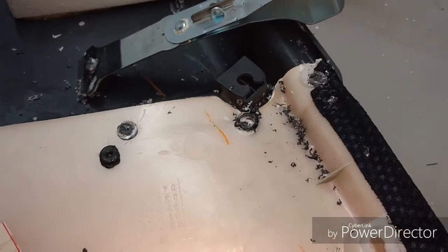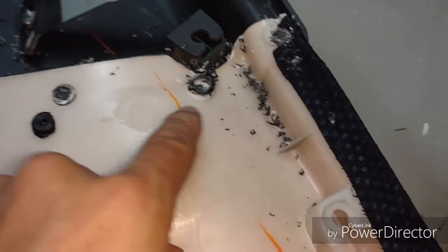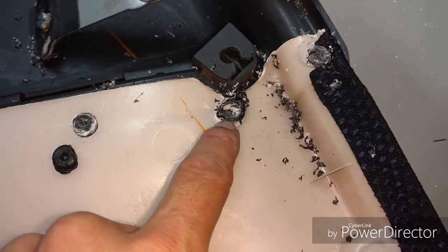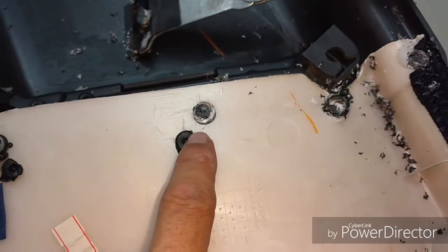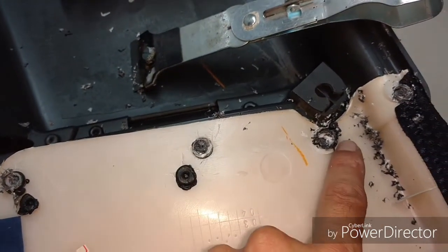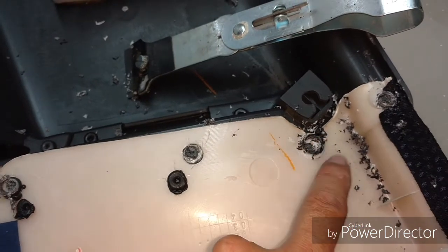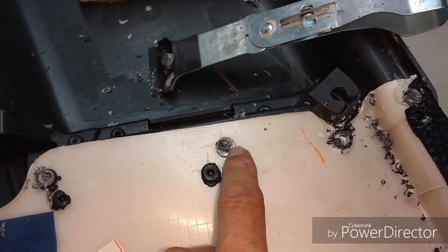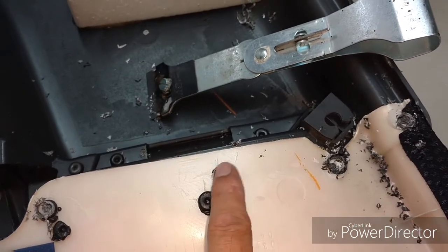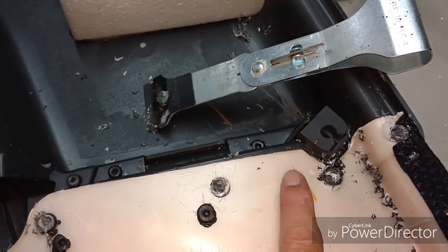Here's what it looks like after you drill it out — you expose the plastic stud coming through the hole. Then after I take the razor blade and run it flush across, I clean up all the plastic that's left over. It's basically just melted over onto the edge, pancaked down — that's the rivet portion, and you just want to remove that.